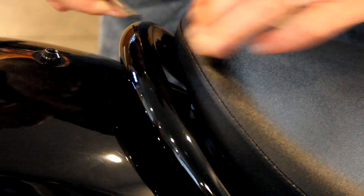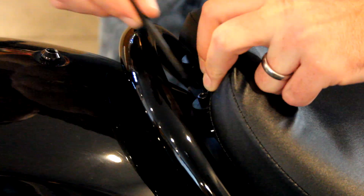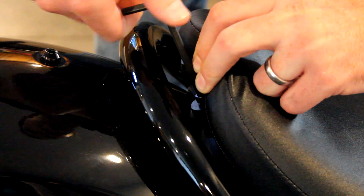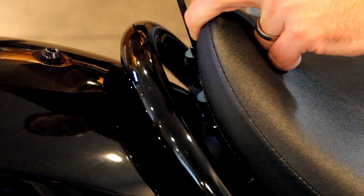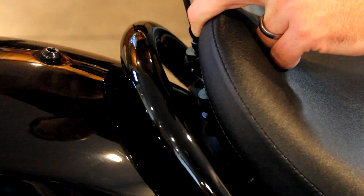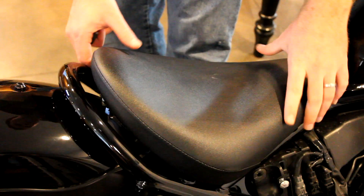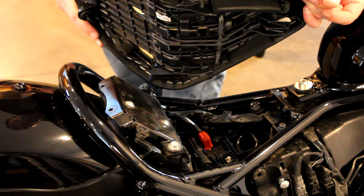So they're loose, and then you grab the long end right here, put it in, and it's easy to unscrew. While you're undoing this one, lift up on it, and once it's loose it'll pop up. Just like that. Then you pull your seat up, backwards, and off.